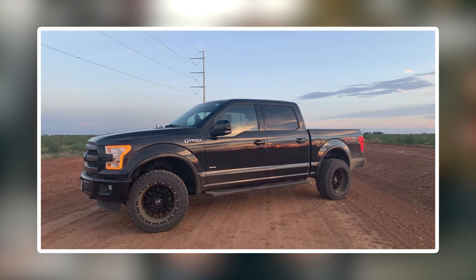Next up going bigger with your suspension lifts is a four inch lift kit. A lot of the gallery is running 12-wides with 33s or 10-wides with 35s. The way you can think about it is if you're going two inches wider, you probably can't go taller with the tire, or if you go two inches taller, you can't go wider with the wheel. So 12-wides if you want the wider look with a 33, or 10-wides if you want it more tucked in with a 35 — either of those are gonna fit pretty good with some trimming. Or if you want to ball out like Jacob Tucker, he's got 14-wides with 33 by 14 and a half inch wide tires. It looks so good, but it's gonna require a lot of trimming. Otherwise stick with your 12-wides and 33s or 10-wides and 35s on your four inch lift.